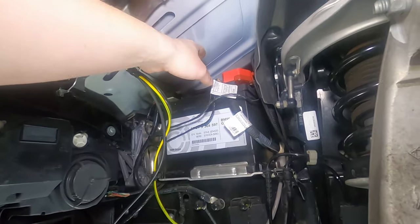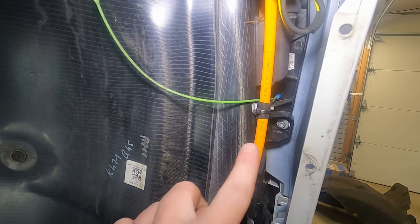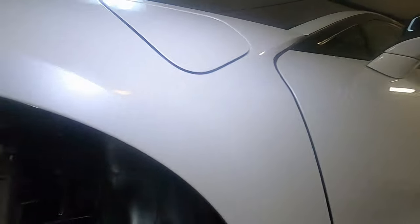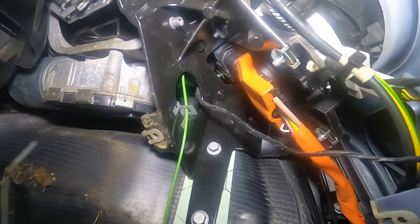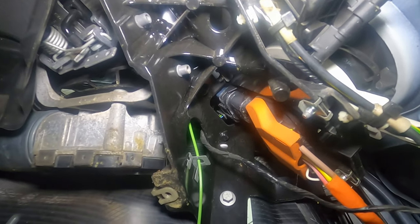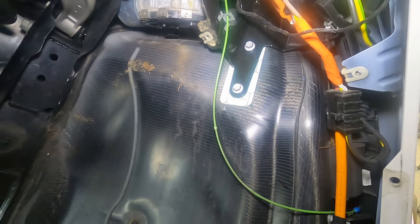We can even see the inside of the hood from here — very cool. And here is where our pull string is inside the door jamb. If for some reason you can't pull your charger out, you open the door and pull on a little plug right back here that pulls a yellow string, which releases the charging port so you can pull your charging cable out. I do know somebody from the forum who had this break, and now it would be difficult to fix because I think it requires taking the fender off to get in there.